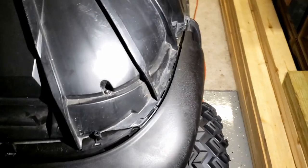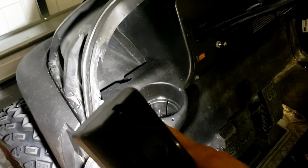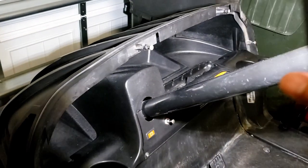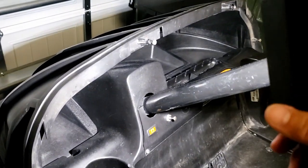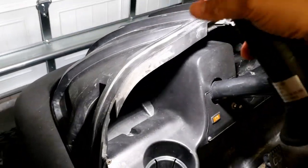So it's not that difficult to do. To take off this brow — the part that actually holds the skin on — it's another four screws. They're the star screws: one, two, three, and four. You take those screws out and I always put my screws back in the hole so I know where they're at. So you would normally take the brow off, take the skin off, and then take everything else off.